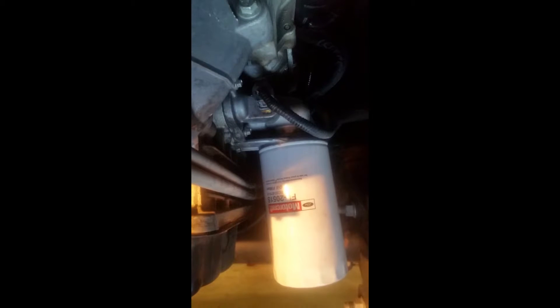Here we are where the oil filter is attached to the block. You can see the cable wiring that comes out right here — that is the oil temperature sending unit. That's where you want to put in your T to put your pressure line for the filter out of that block. I will warn you that when you do pull your temp sensor out, have a pan underneath because it will leak out probably a half to a full quart of oil and it will make a mess.